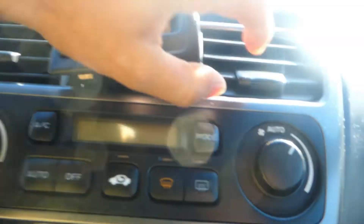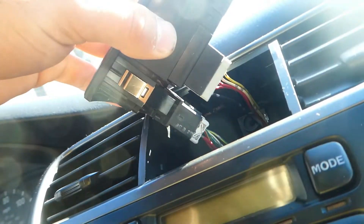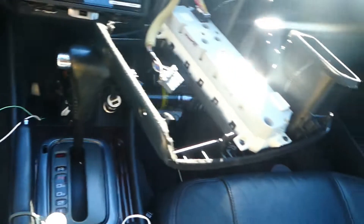When you want to take your climate control out, first things first you pop it open right here and clip it. If you've never removed this, you remove that screw right there and these two screws on the bottom. Once you pop the screws off, you're able to pull this out by just pulling from the bottom — pull it up. There's clips with buttons on the bottom. Mine are real easy because I'm always pulling my radio out, but yours might be real hard. Then you remove these four screws and you're able to pull it out.